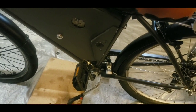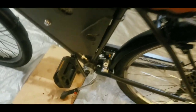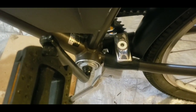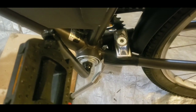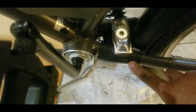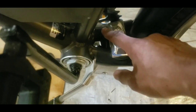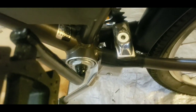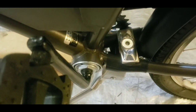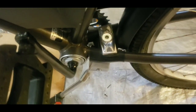On Bike Talk episode three, I went ahead and made some adjustments and fixed a few things that were not holding up right with the bike build. First thing was the kickstand — the kickstand used to move a bunch after you lifted it up and put it down a few times, and I was constantly having to tighten this nut here in the middle because it was constantly getting loose. But after I put these pieces of inner tube here to give it grip, it doesn't move at all. It is as stable as it was the first day. No issues with it getting off level and having the bike tilt anymore.